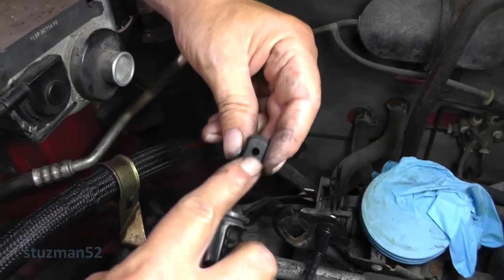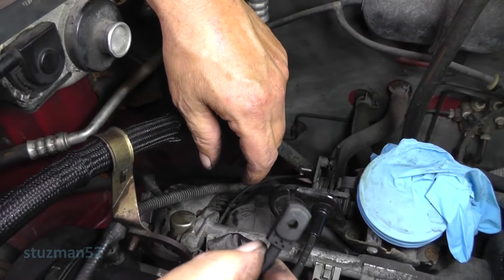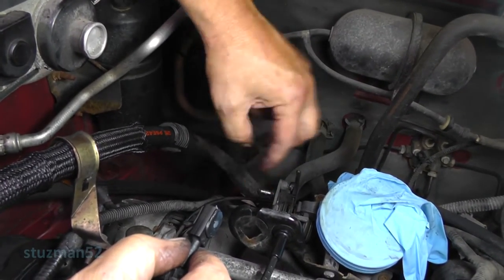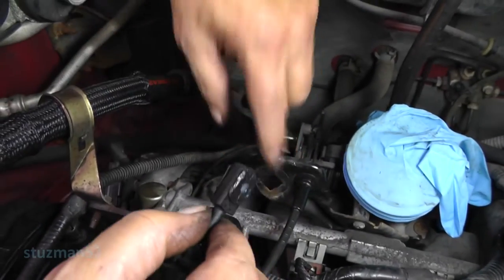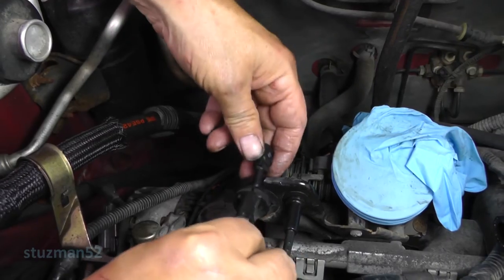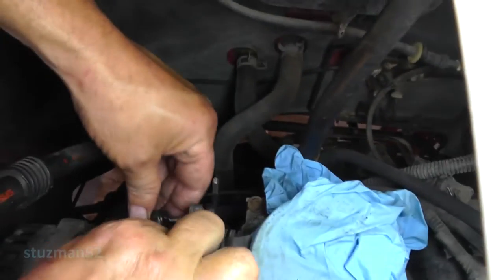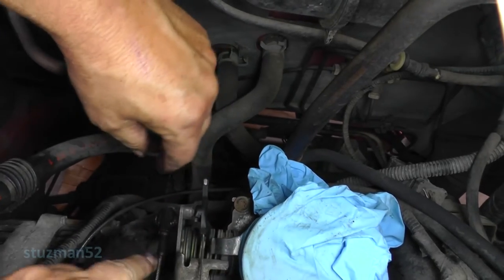Let's do the throttle linkage. Make sure that your rubber grommet is seated inside - that's what it should look like. Now to make this slide over a little easier, I'm just going to put a little bit of silicone paste - that'll serve as a lubricant. Get a little bit down in the hole. Drop them through, put them in, turn them clockwise - that'll make them lock. Pull the cable out, line it up with the hole, and let's see if we can get this thing to slide over that shaft. Easy peasy.